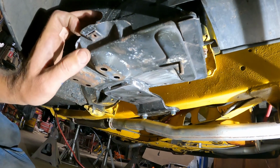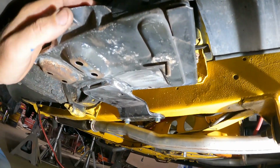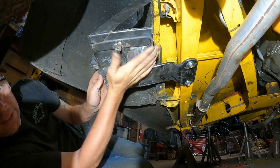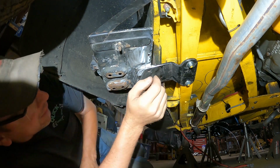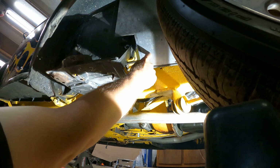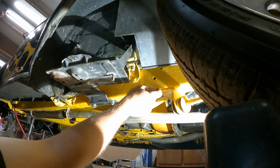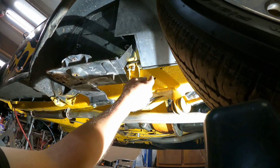All right, bam, this worked out great. I've got my two bolts up into the body. Let me set this down. It's super beefy. It's not going to go anywhere, so that'll definitely support the battery, no problem. I think I'll let the battery cables come down, and I'll notch out the corner of this aluminum inner fender piece and have them go right up over the frame. There's going to be a battery cutoff switch on the firewall. I'll mount to that, then go down to the starter.